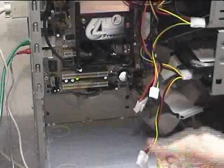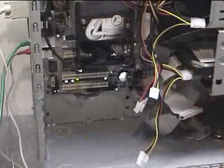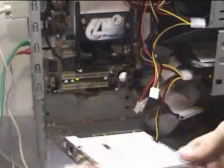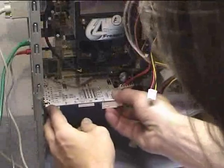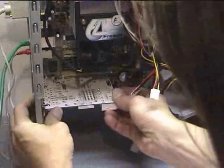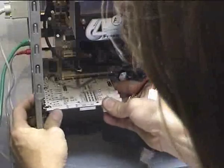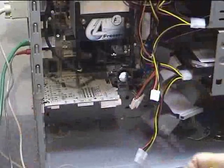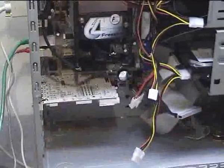Right, okay, I've screwed the thing back together, and it actually didn't take that long. It's not as fiddly as you might think. So I'll just bung it now. You can see that the RCA socket's now facing out again. So I'll just bung it into a PCI slot on here. Now, interestingly, this motherboard is a mini sort of ATX board, and it's only got two PCI slots. So just chuck that in the socket there. Screw it in. And there she is installed, lovely.